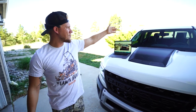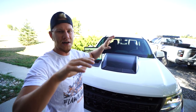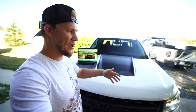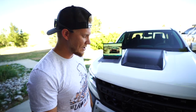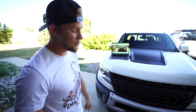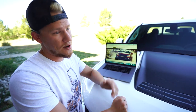The reason I like to have a light bar on the bumper rather than up top, especially with a white truck, is because when you're at night, this has no reflection - it just goes straight out to the road. When you have something up top, especially on a white truck, it bounces off the hood right back into your eyes. No matter how you have it pointed, there's going to be some light bouncing back into your face. That's the problem I have with the Dually. For off-road use, it's always better to put the light bar on the bumper. I'll probably end up going with Rigid Industries.